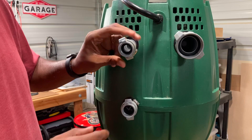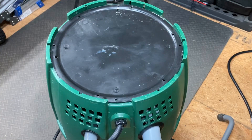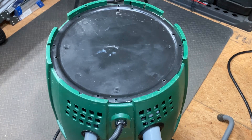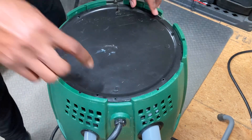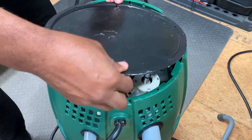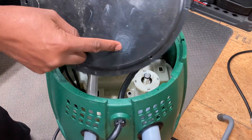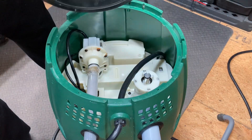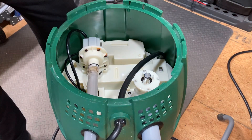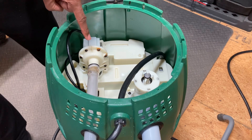Let's troubleshoot it and see what's going on. For simplicity, I went ahead and flipped it upside down on a five-gallon bucket, and I removed six screws that hold the bottom panel and lifted it off. As soon as I lifted it off, I noticed there was a water spot right here where water has been dripping down, and as I look straight down from there — the water pump. Let's take a closer look.